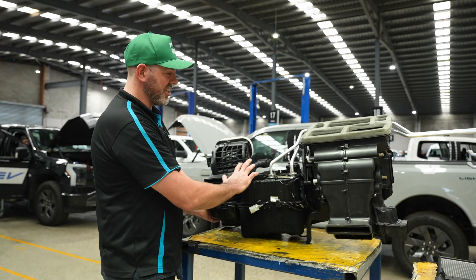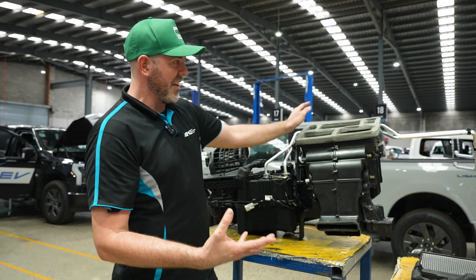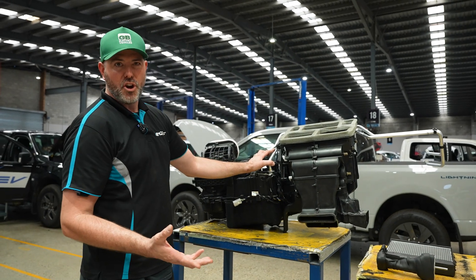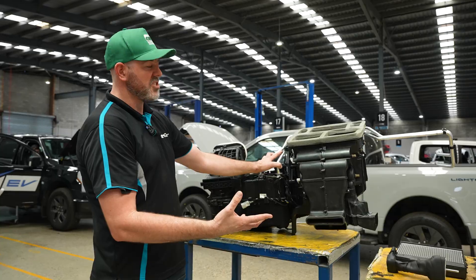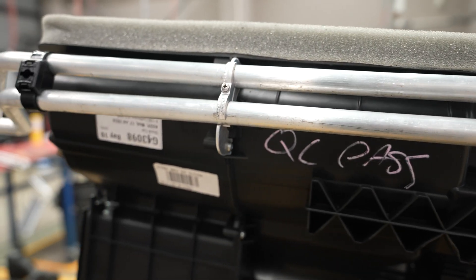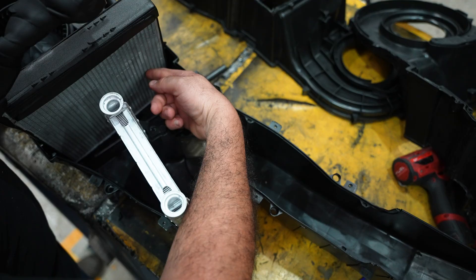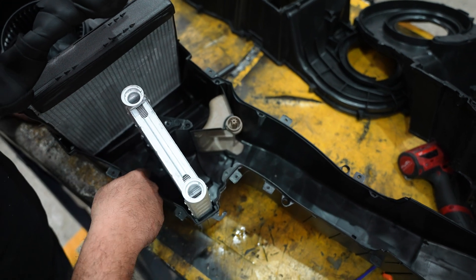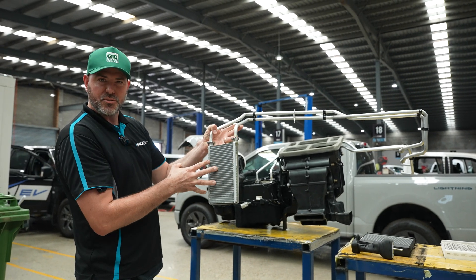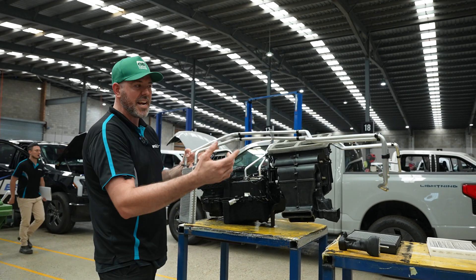The next major part is the heater core. On a conventional ICE car, the engine heats the coolant and it's pumped through the engine's water pump into the heater core. On an electric car, because there's no engine to heat the coolant, they use a heat pump system — very similar to a reverse-cycle air conditioning system in your house — along with a heater element in the engine bay. Electric pumps then push hot coolant into the heater core. Hot coolant passes through, air is blown through it and is heated as it passes out the other side, giving you heated air in the car.